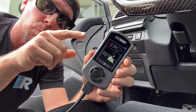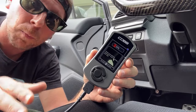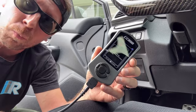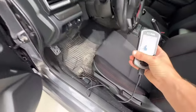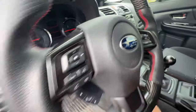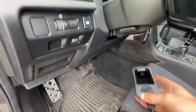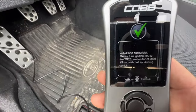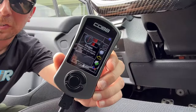Pretty straightforward at this point — we don't want to make any sudden movements. I'll put the Accessport up on the dash so I can see it through the glass, close the door so the dome light doesn't draw any amperage, and just wait until the process is complete. The screen then shows a warning: please turn and leave the ignition in the off position to begin vehicle re-initialization. We turn the vehicle off, hit OK, wait a few seconds, then turn the vehicle ignition back to the on position and hit OK again. Installation successful — we have successfully downloaded our Stage 1 93 map.